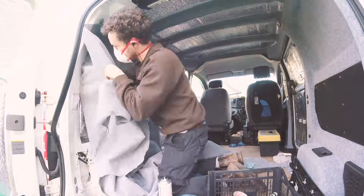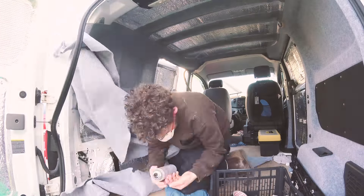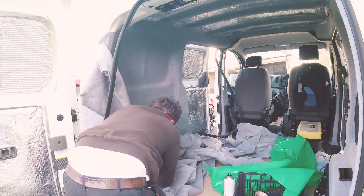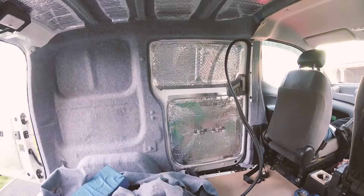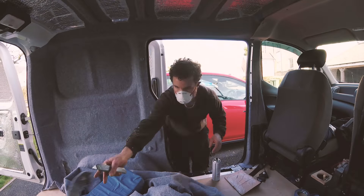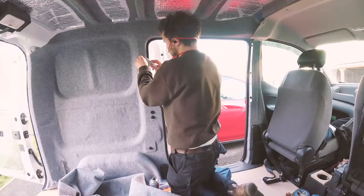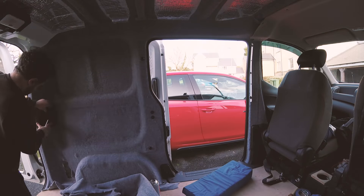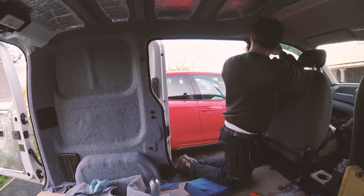The only thing I did differently was that I didn't cut out the section of loose carpet under where the black panel will sit. The reason being that when I did this the first time I nearly cut off too much, but also because I was able to work the carpet around better so as not to create too much tension in other areas. It was still a challenge and got tricky around the seat belt again, but with patience and time I was able to get the carpet down even better than before. Doing this side took the best part of three hours but definitely took over four hours for the first side. Once the carpet was down I added all the fixings back and cleaned up any glue overspill.